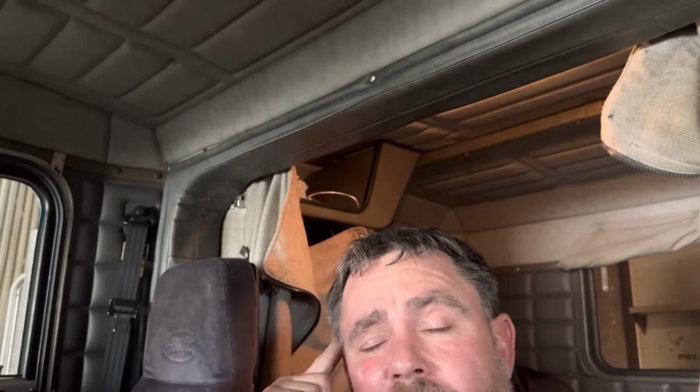And then in spring, just start all over again. Probably leave the evaporator in the truck, change the expansion valve in the sleeper, put a new orifice tube in the cab here, a new accumulator, and a new compressor, of course, and a new condenser out front. Just do all that. I want to check my lines and everything real good before I do it. I'll probably pump a little bit of Freon, or at least make sure it's got pressure on it. If it doesn't have any pressure, I'll put a little Freon in it with some dye to make sure it doesn't have any leaks.